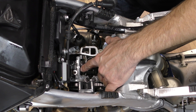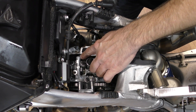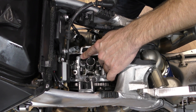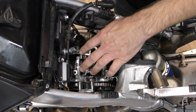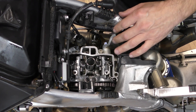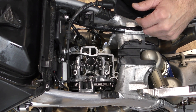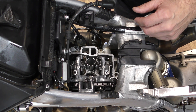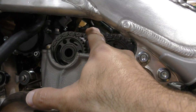The left side intake was at 0.15 millimeters before and now it's at 0.13 millimeters. The right side intake was at 0.14 millimeters before and now it's at 0.12 millimeters. I'm going to go ahead and adjust the intake valve clearances to bring them back toward the middle of the specification. I could probably let it go another 10 hours or so and then recheck, but race season is going to restart in a couple of weeks and I'd rather go ahead and get it done now.